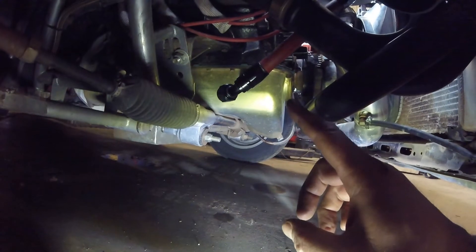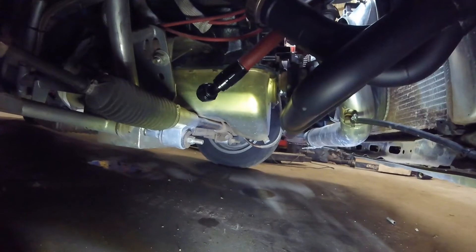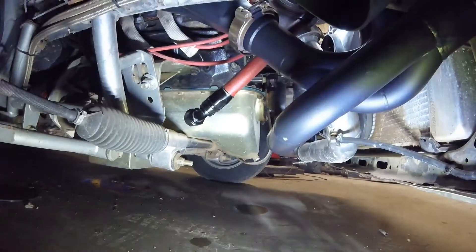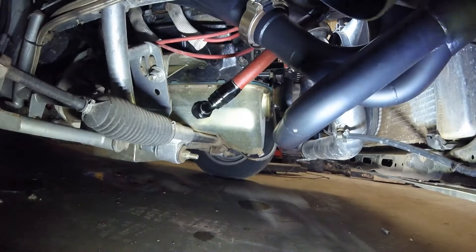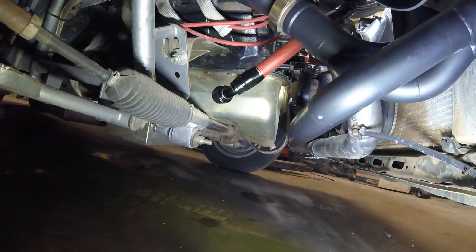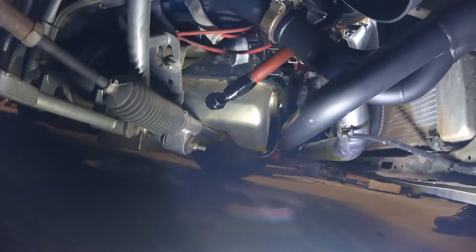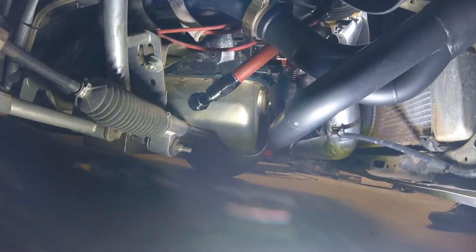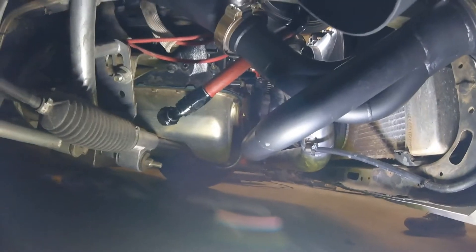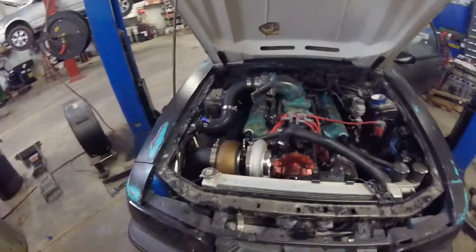Exhaust is all done, everything's looking good. Last thing we gotta do is tighten up the oil drain fitting onto the oil pan on this side, and then we gotta go tighten up the oil dipstick tube on the other side. Pretty much it at least for mechanical stuff. Oh, the other thing we gotta do - that bolt right up there, we've got to connect our ground wire for the engine block because right now nothing's grounded, which is super awesome. So we gotta get that done too. Now that we've got our injector ground on, she should come right to life.